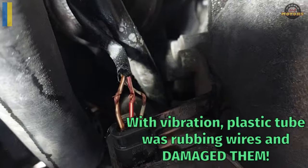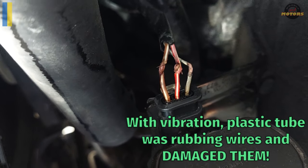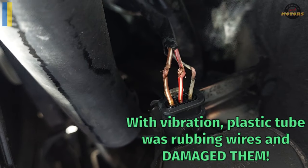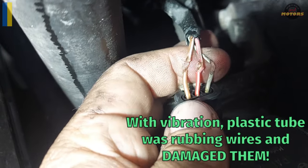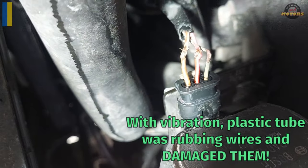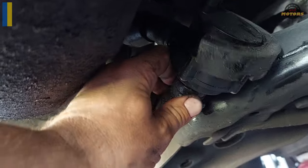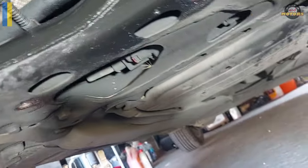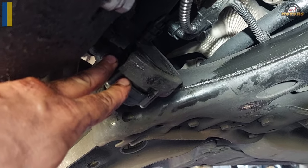So if you get a coolant circuit error for the coolant pump or charged air pressure — you'll see it in the description — that exposed wiring could be the issue and you might not need a new pump. As for the second pump, I'm going to replace it because the wiring there seems secure. I have a spare pump anyway, so I'll replace this rear pump which is behind the engine towards the subframe.